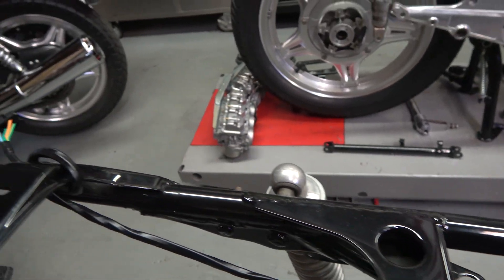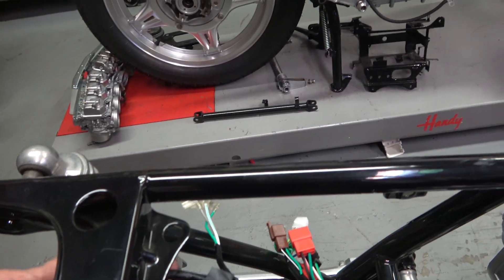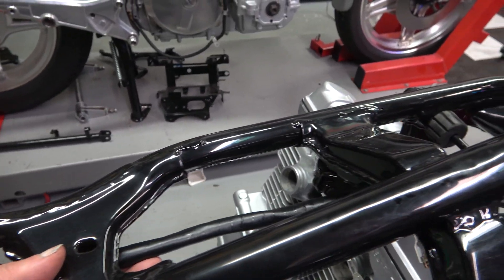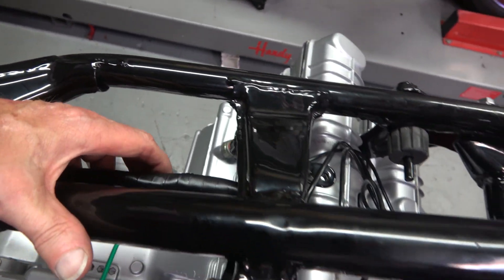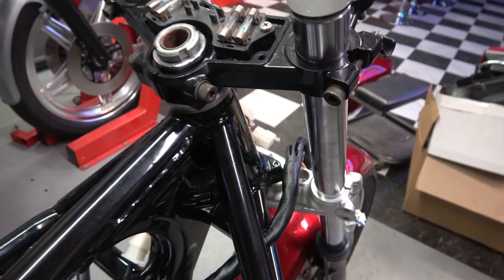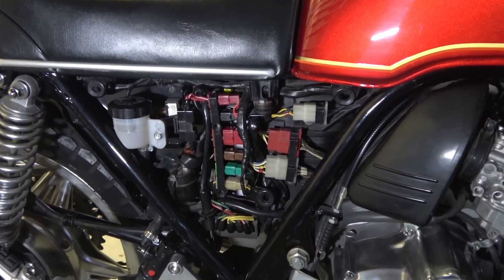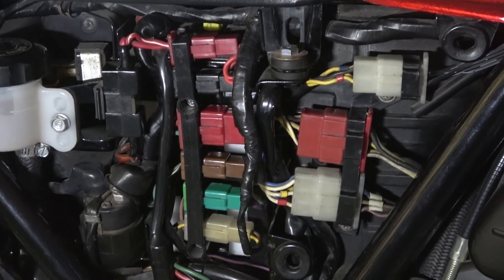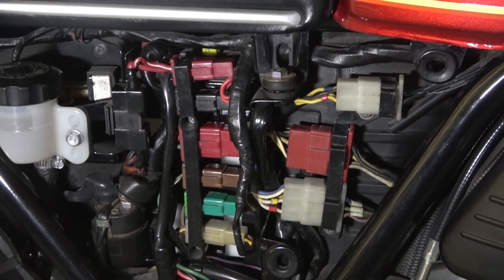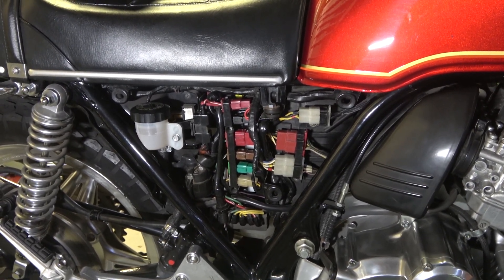It just runs along underneath all the rails and cross members and then back, and I just tie it until I install the tail light. All those color connectors should be on the right-hand side of the frame — they're just dangling in place right now. Once I get my straps cleaned up, I'll connect the main harness to the frame as shown on the unrestored bike. Here's my show bike with all the connectors connected to the battery box — they look really nice once properly located, which is why the routing is so important.